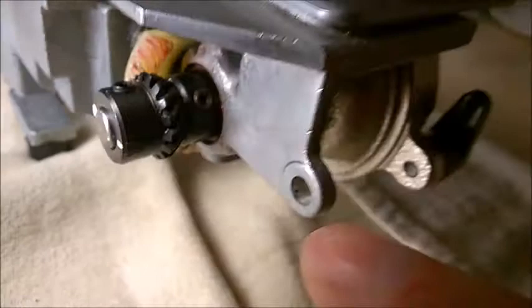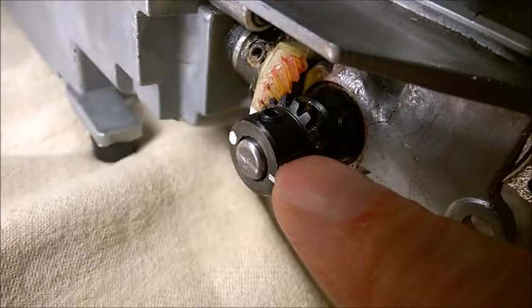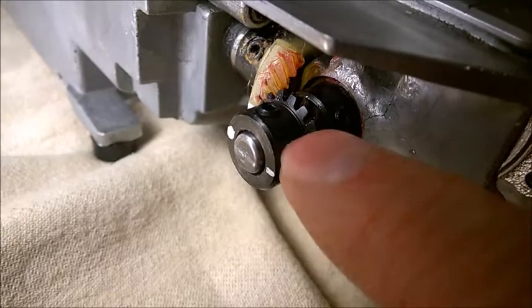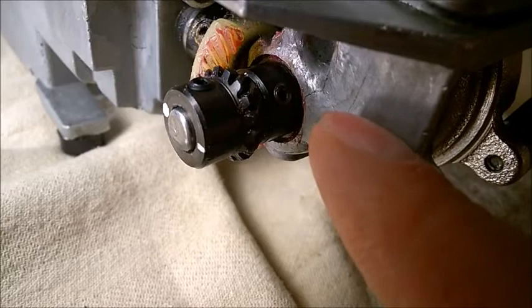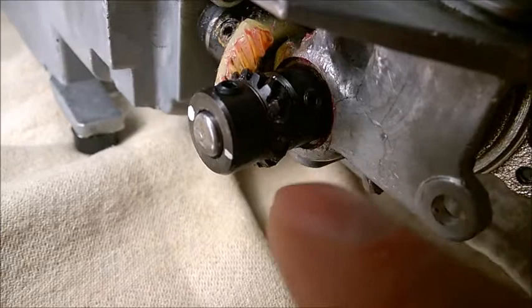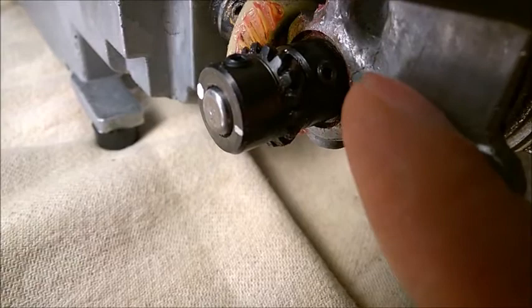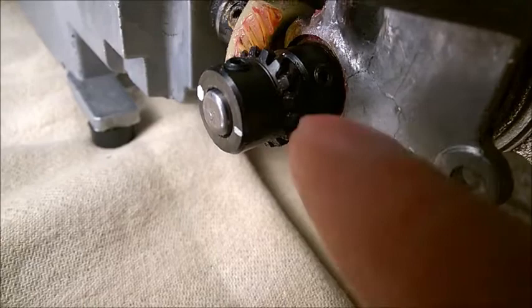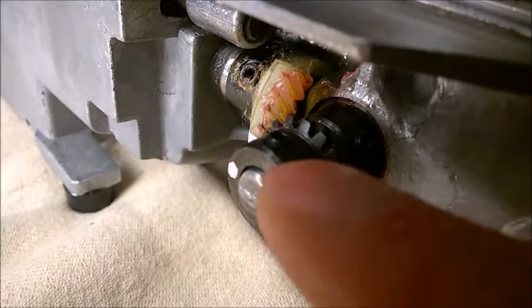It's crazy to remove and crazy to put back. It's also crazy to slide the shaft out the other side because on top of all this there is a key on the shaft — it's not used to align the gear, it's just a key. When you try to slide the shaft out, that key will scratch the bushing inside, and that's not good — you'll feel it, the shaft doesn't want to come out. If you try to clean the shaft and didn't manage to remove it, only use steel wire mesh, never sandpaper. Don't try to scratch the collar or the inside of the bushing — that must not be scratched in any way. Put a couple of droplets of engine oil and put grease on the gears.